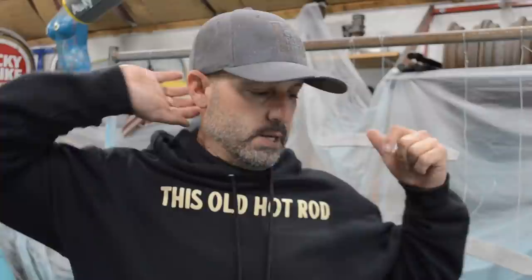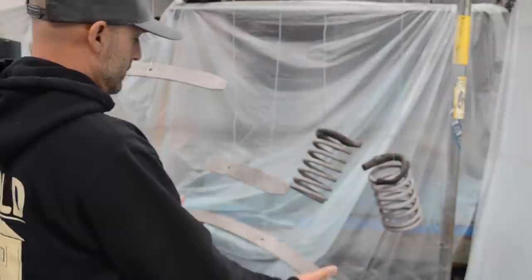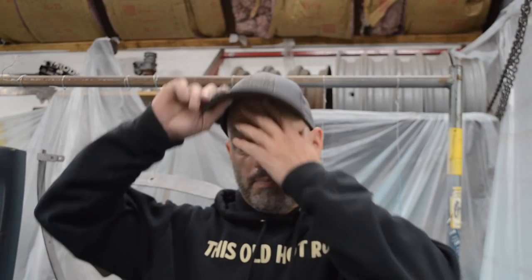So that being said, I haven't had a lot of progress in the garage the past few nights, but what I did get done is, you can see hanging up on my little rack here, I got my springs sandblasted. This is just a few of the leaf spring pieces. These are the top pieces. You saw a few seconds ago in the video that I was working with the SCT to clean up the majority of the rust and the buildup on the larger portion of the front spring. Those are all cleaned up. Those are ready for epoxy. You saw the pieces in the sandblaster.